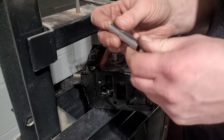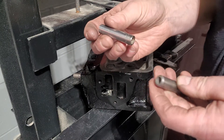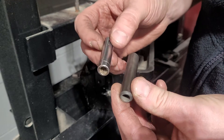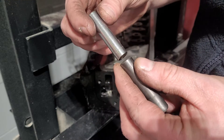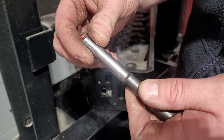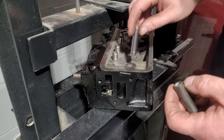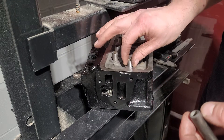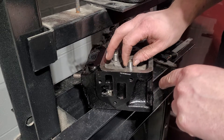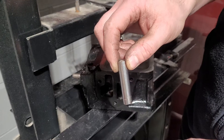Get it in your toolbox — you shouldn't do much damage to it, you shouldn't do any. If you have a spare one, great. The reason why I use that is, if we look at the normal valve guide, it's pretty similar in size. You can flush it up, it will bump up to it pretty good, but it's slim enough to fit in the hole and actually go up. It's the same size, and it just — there you go. So I don't have to worry about pushing something out and getting something else stuck in there.